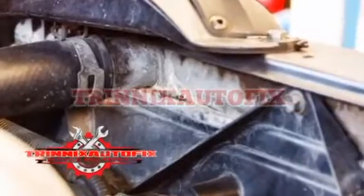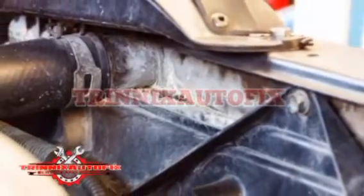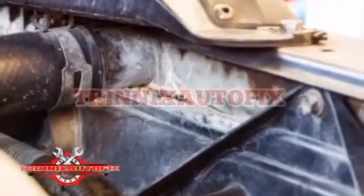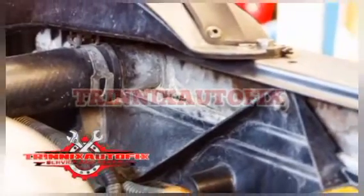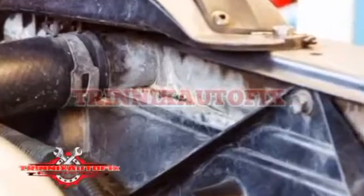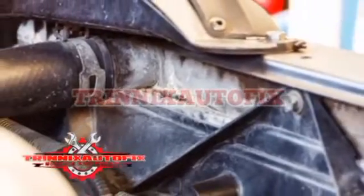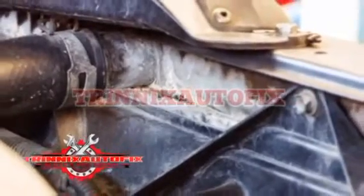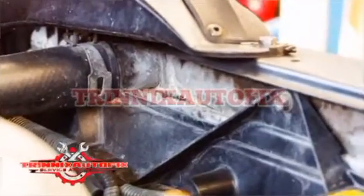Once the coolant has been removed, loosen up the clamps holding the radiator hose in place. Carefully work the hose off of the clamps. If you can't get the hose off easily, use a knife to slice the hose at each end. Take off the clamps. Inspect them while they are off. If they are worn, now is also a good time to replace them.